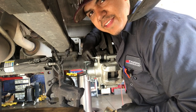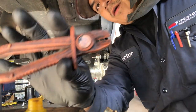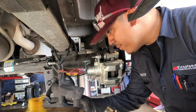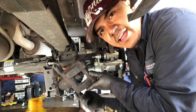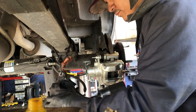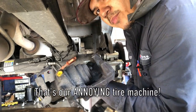There's a plug right here on the new caliper - you got to take that off. I'd keep those plugs, they're always useful for plugging up holes. I'm going to use pinch pliers so I won't lose a lot of fluid on the brake line. I need to squeeze the clips to get that brake cable out of there - just use a pair of needle nose pliers to do that. It's an 11 millimeter right here and I can get that old caliper out of there. I'm going to use this plug on the old caliper so I won't leak any fluid.